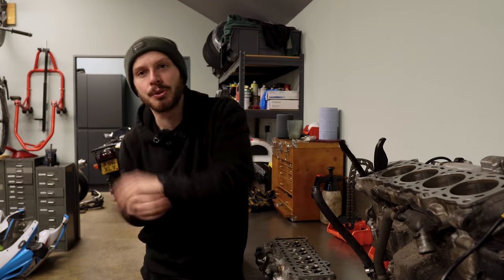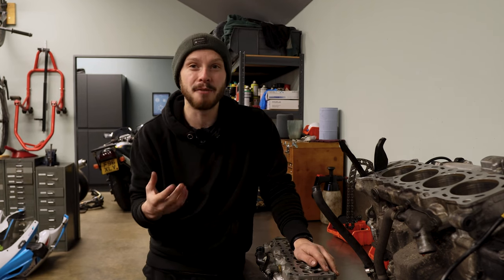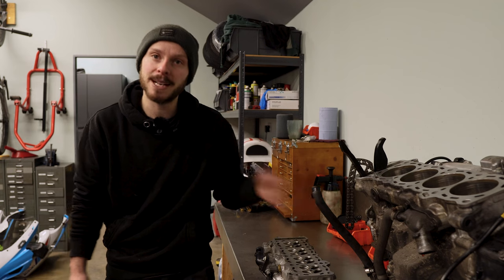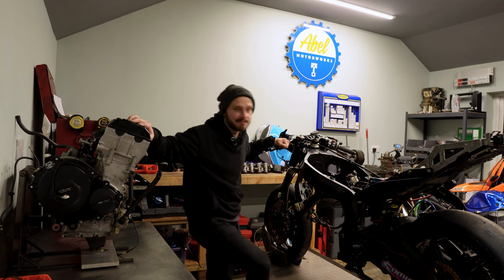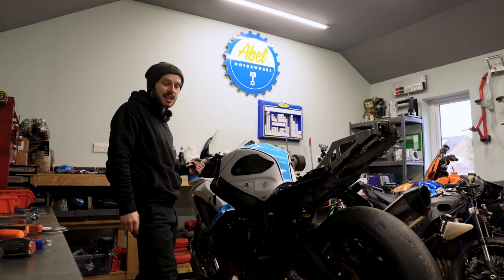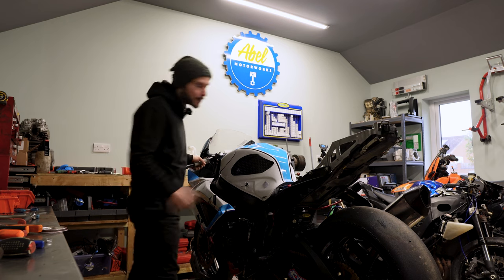And that's how we get back to this point. After I set the valve clearances we did a leakage test, and found across-the-board dropping compression. It turns out there was a big carbon build-up on the seats and valves, which was causing them to not seal properly — and there was your issue. I've cleaned it all down and assessed all the parts. I'll be honest, I did it in a bit of a rush because this bike is going to Spain in a few days. The seats have been redressed, the engine is back together and going straight to the dyno — it's half eight in the morning, then it's on a crate and off to Spain first thing tomorrow morning.